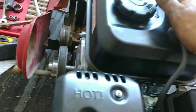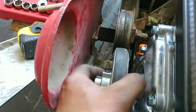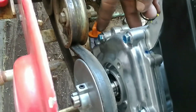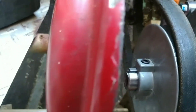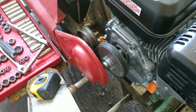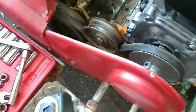I mounted the motor by eyesight and with the pulley loose, I can center it up on the tensioner pulley, which is what grabs and causes it to drive. There's not a lot of room front to back — if I came back any more, that bolt would hit the rear oil fill cap. I just hope I'm back enough so that when you press the clutch/brake, it puts enough slack on the belt and holds a neutral/stop position. If not, I may need a slightly smaller tensioner pulley.